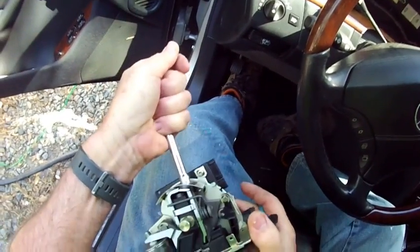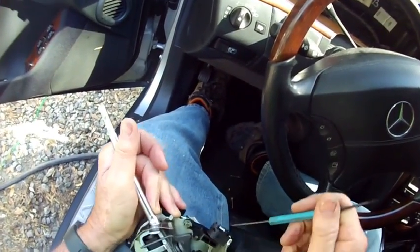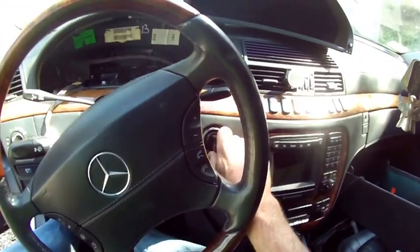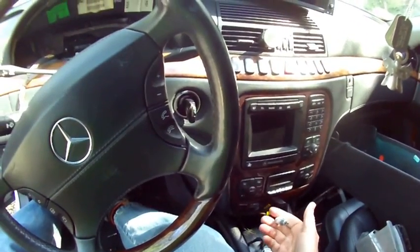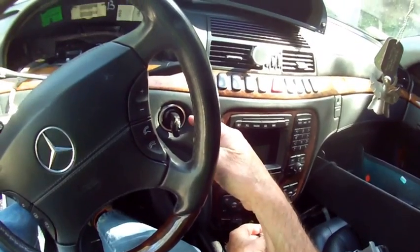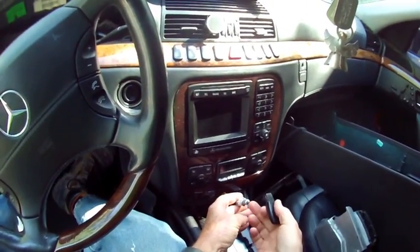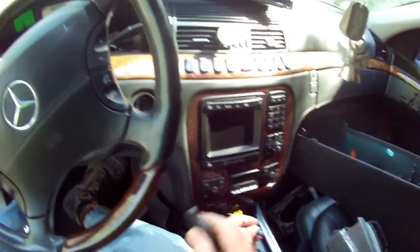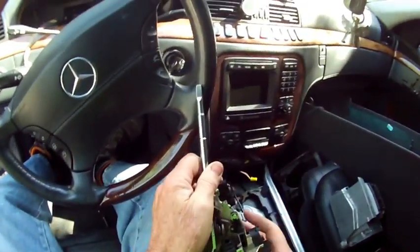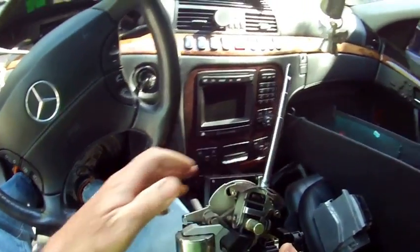The other piece with this rotating cam is that when you go to park, this roller is going to make contact and push this up against where that cable was. Right now with the key in, I can turn it but I can't get the key out. This is a mechanical cable - so if you ever get in this situation where you can't get the key out, pressing this button releases it - you can hear it click - and then you get the key out. It will remain in a retracted position; as soon as you turn the key on, this will pop out and allow it to come out once the car comes out of park.